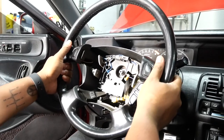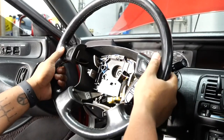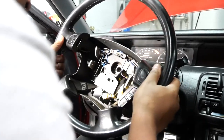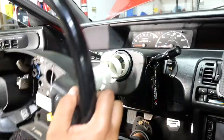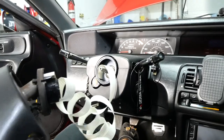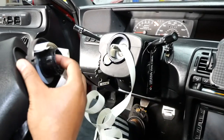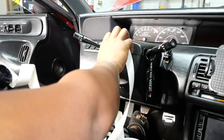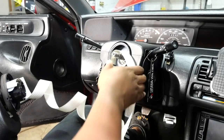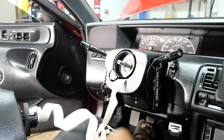So now this is loose — sometimes it's tight and you might have to bang it a little bit, but this one is actually loose so that's good. We have some connectors in the way we got to slide out of the way. Well, that happened — but that's fine because we don't need this. This is your clock spring; it allows you to have a horn and airbag in there. But we don't need this, and I destroyed it — but it's not a big deal. Don't be like me, be gentle with your stuff.